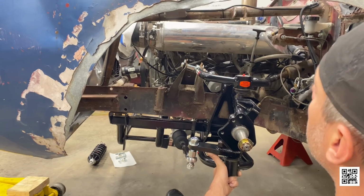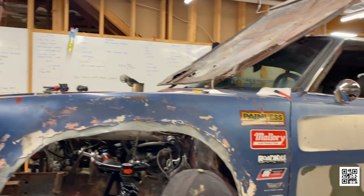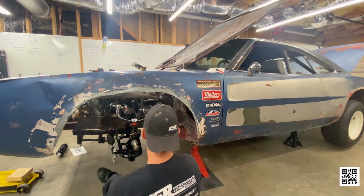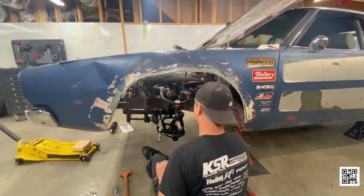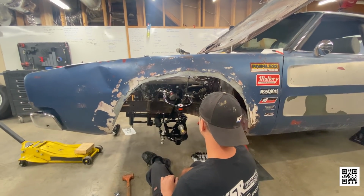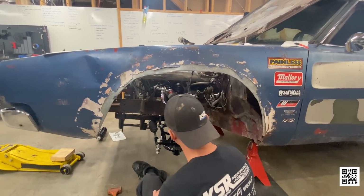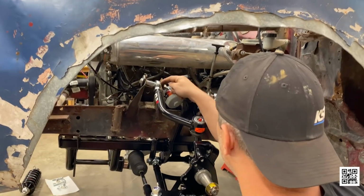Okay, step one, we'll level the car. Yeah, I think that's a good first step. And then maybe we work on moving this forward to get this contact point going one way or the other, because it might be that this spread here isn't where it was stock either. Well, and also the upper control arm is touching the mount right now. Right here? See that right there? Yep, it's bound up right there, but that is full droop, let's call it. So it won't take much.